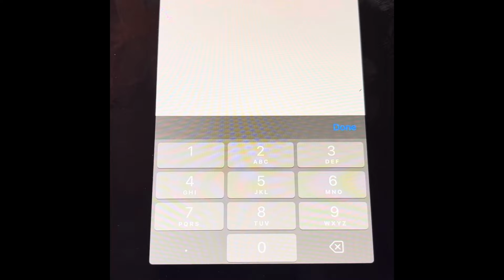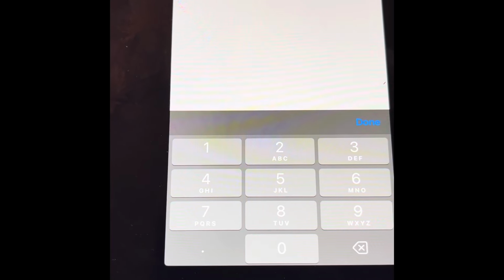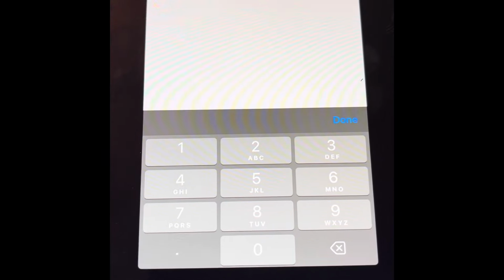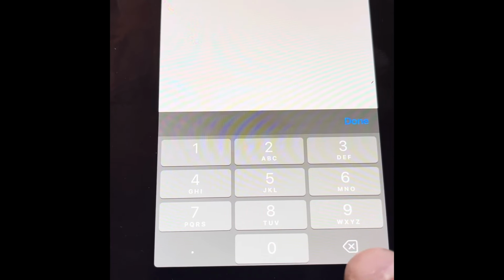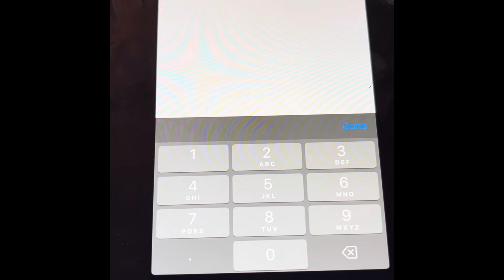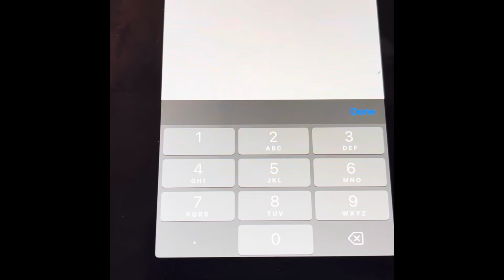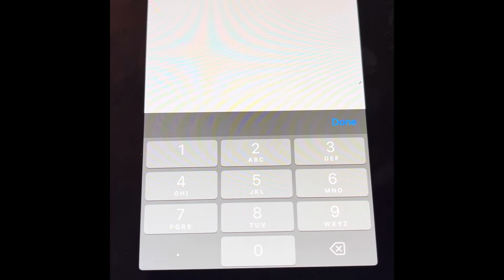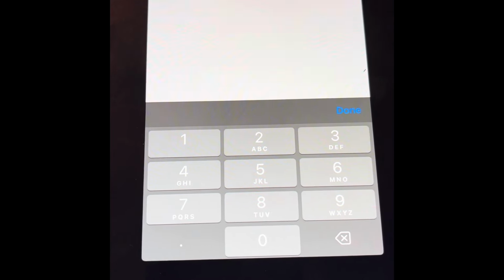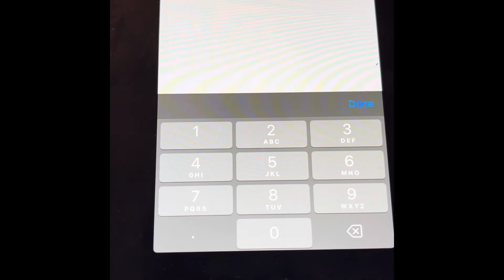It also has a low humidity alarm. At what humidity do you want to be notified if you run out of water, for example, or if the humidity drops too low? I'd like to keep it around 10%. It allows a little bit of variation. Now this machine, unless there's a blockage or the pump stops working or something, it will never get down to 10%. So normally that's an indicator that maybe you ran out of water.